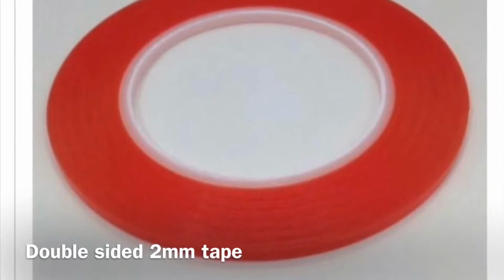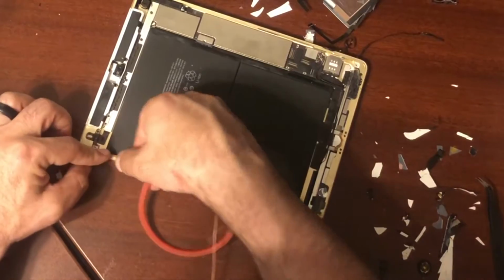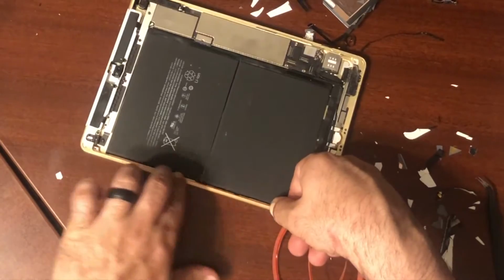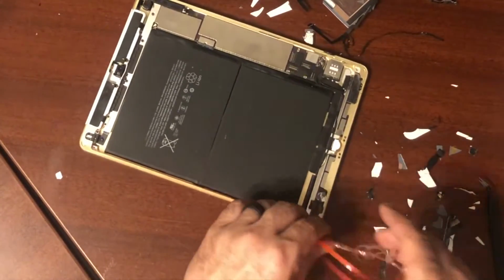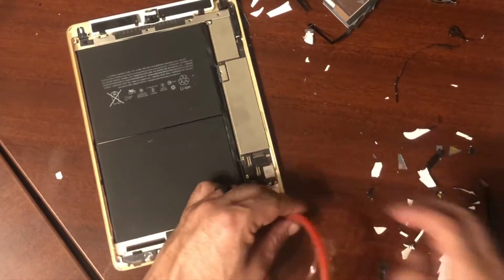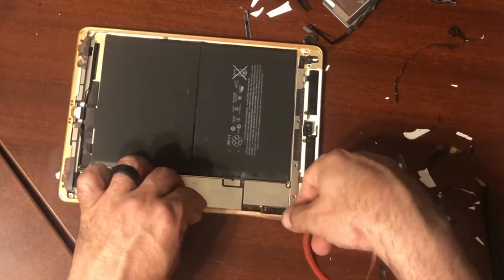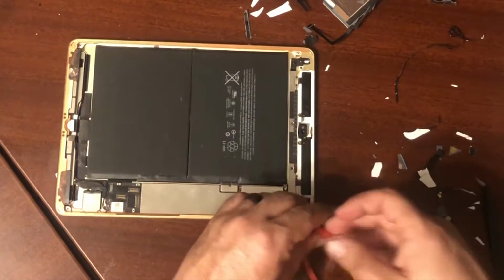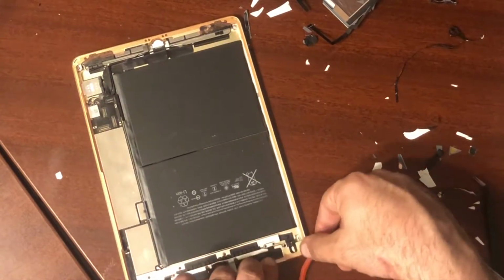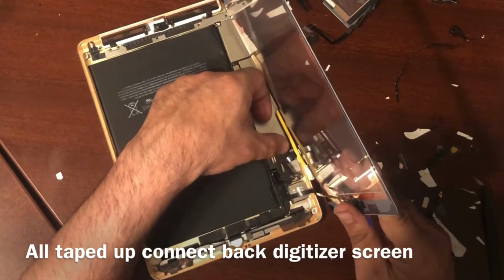Next thing you want to do is use some 3M tape. I'll leave a link in the description on this one as well. This one's 2mm wide. This is the best for these iPads that I have found. As you're putting this tape down, make sure to be pressing on the frame as well. Make sure that you are not covering any holes like the camera or anything like that. All we're doing here is going around the edges. There will be tape on the screen that we ordered as well. I always put tape on the actual frame, and then I use the tape from the screen. Seems to go down a lot better.